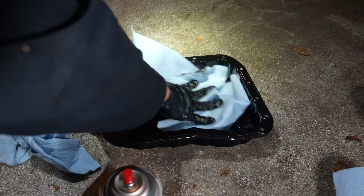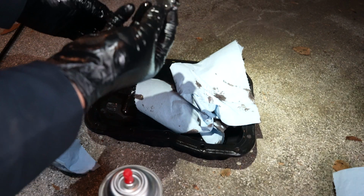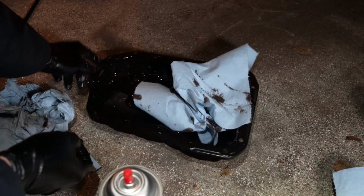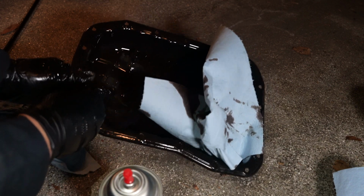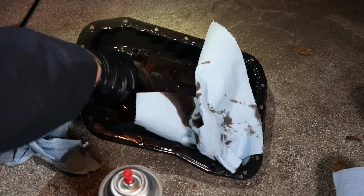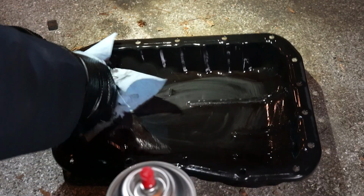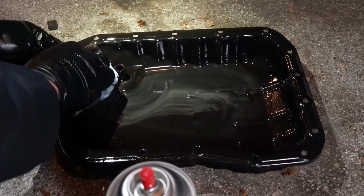You don't want any of that old transmission fluid that we're trying to change out, as well as any potential sludge. There are also these two magnets that will need a wipe and make sure that they're clean. Now you may see some shimmering metallic substance or particles. That's normal. And I think that means that the magnets and the fluid is doing its job. But if you see large flakes and spiky shards, it's a sign to maybe save up for a transmission rebuild or a new transmission.